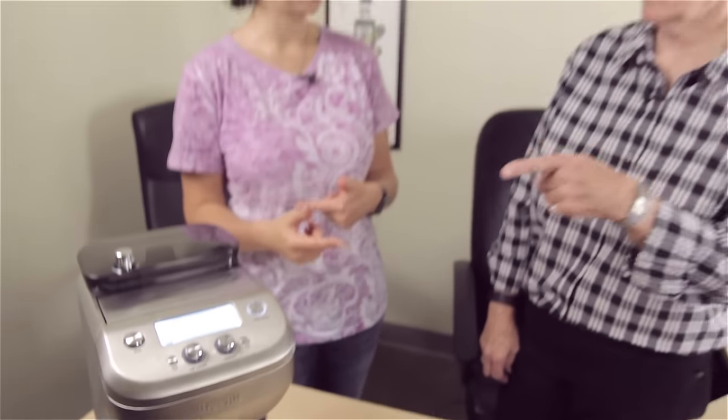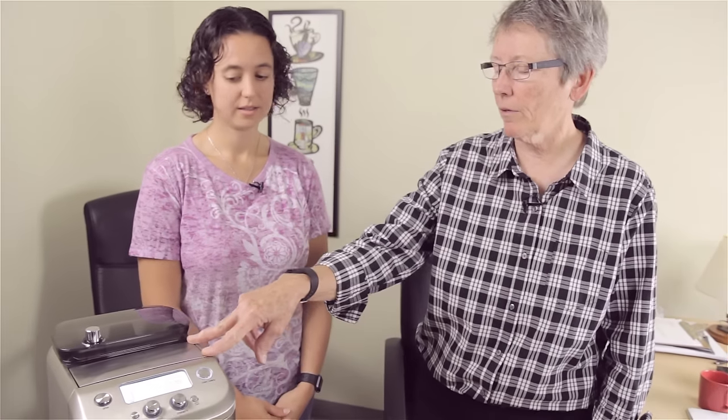And then you want to rinse through. You put in a fresh 12 cups of water, and then you use the pre-ground setting — don't put any coffee in there and just rinse it with fresh water. That descales it. Two full tanks so you make sure you don't get any of that vinegar afterwards, because that would not taste good — it doesn't improve your coffee.